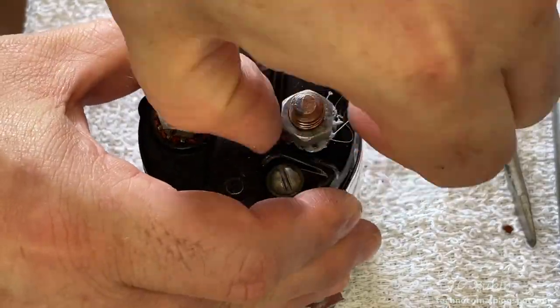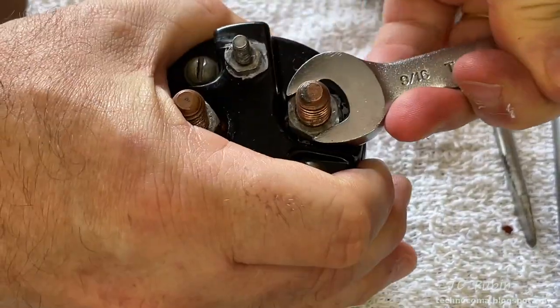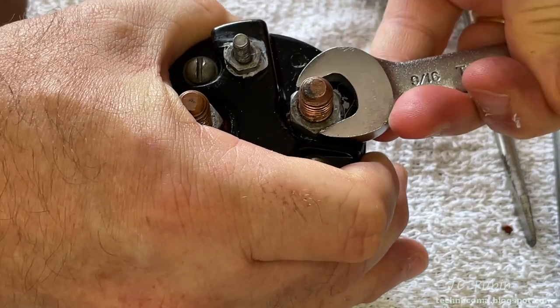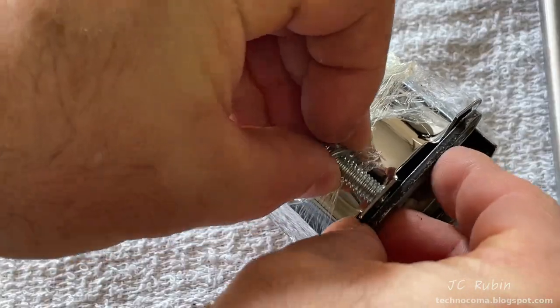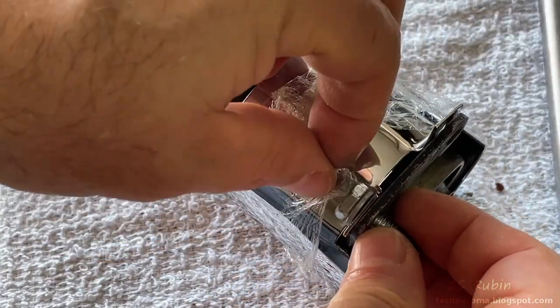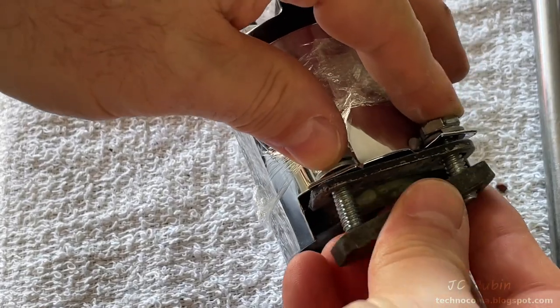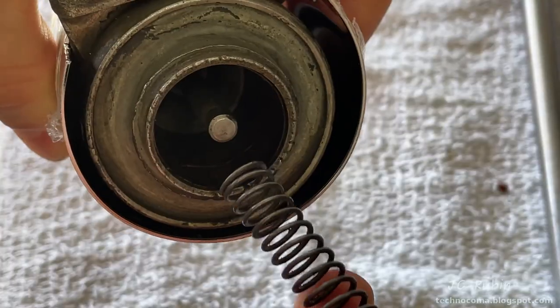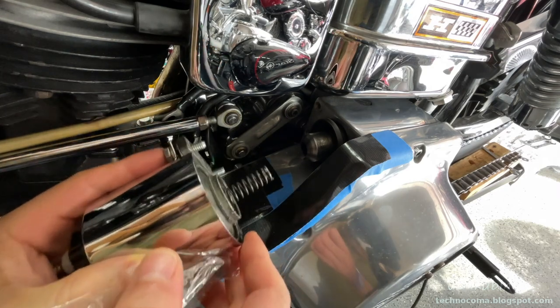Again I place the nut over, trying not to push down on the stud, and once I get a couple of turns I'm actually pulling up as I turn on the nut to tighten it down. Clean up and move on to the next step. Laying the solenoid on its side, I place the mounting hardware back in, followed by the spacer and then the spring.